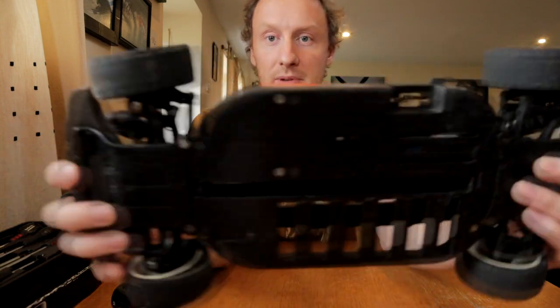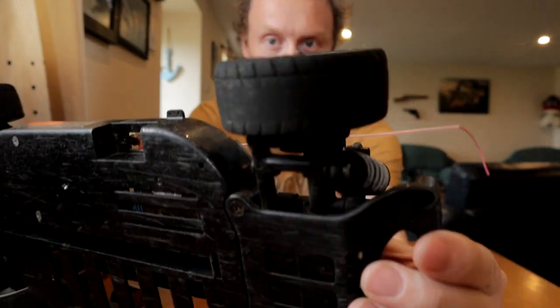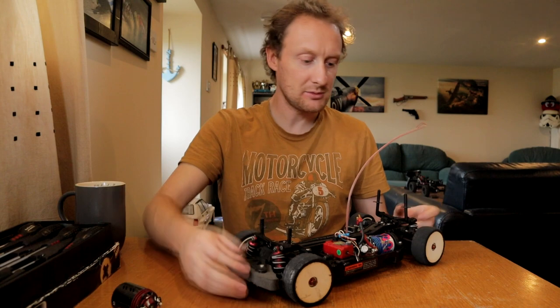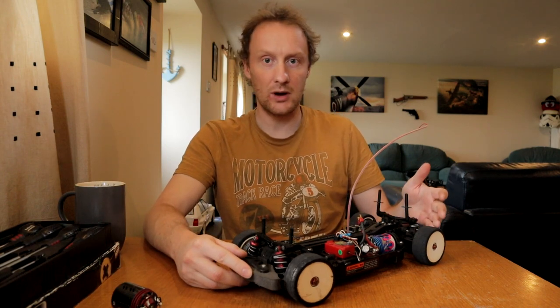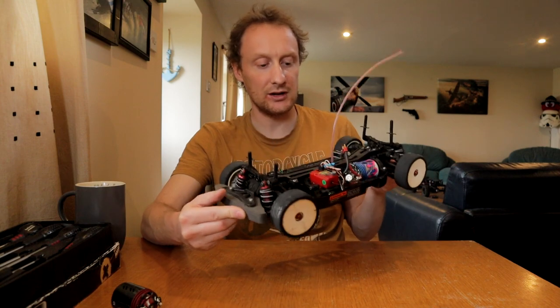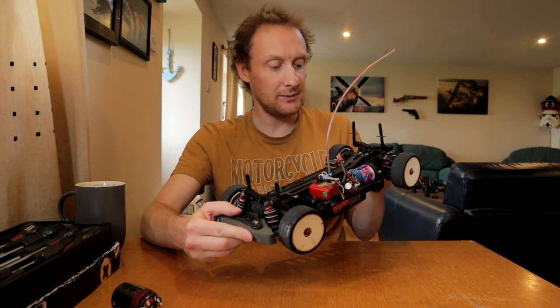Not helped by these T27 tires. Yes, they are absolutely bald, there's no tread left, but the point is the compound isn't particularly grippy on these things. Because it was dry, slick tires would have been fine. They were easily overwhelmed. T27s are just multi-purpose tyres. They're not particularly great, so I've ordered new wheels and tyres. We'll see what they're like.